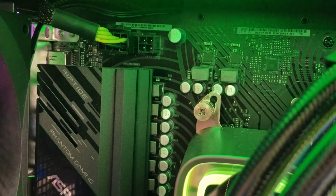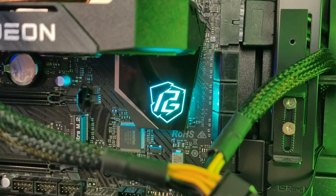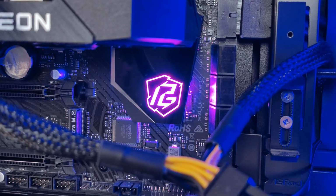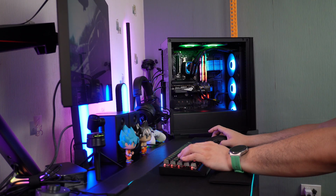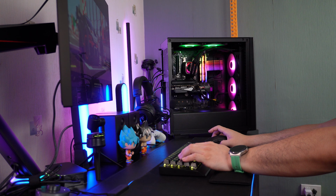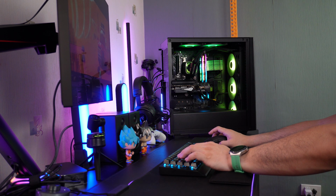Then, it also has one HDMI output. Then 6 SATA ports, one Hyper M.2 PCIe Gen 4 x4, and of course one Ultra M.2. Then for USB, it supports three USB 3.2 Gen 2, 10 USB 3.2 Gen 1, and 8 USB 2.0. Then its audio is 7.1 channel HD audio. Then it also has a Killer E3100G 2.5G LAN port. And its form factor is ATX.